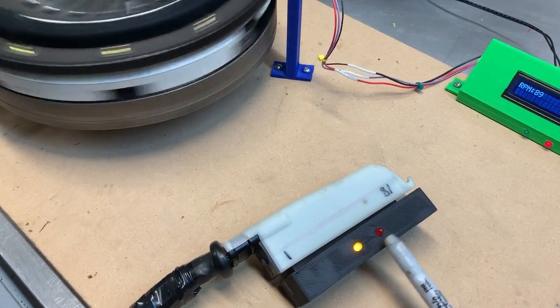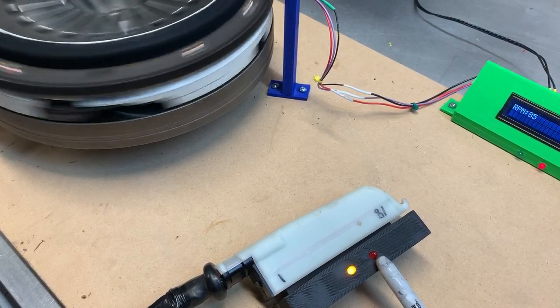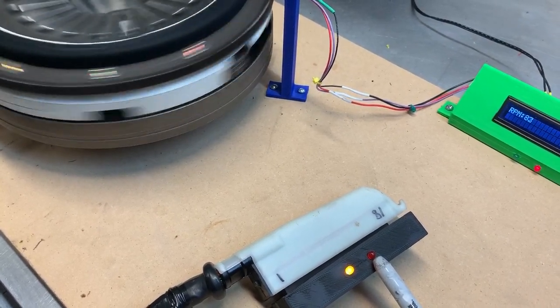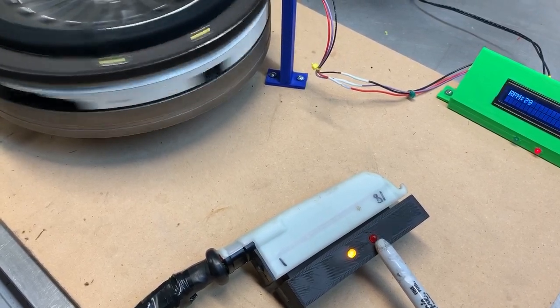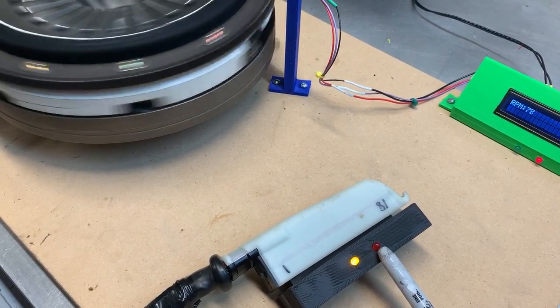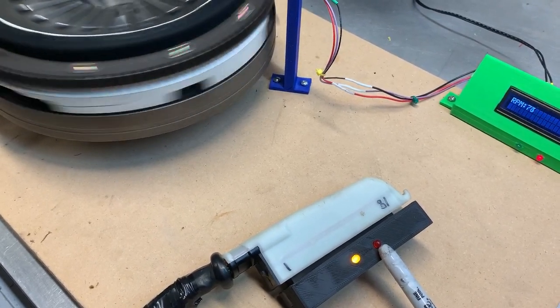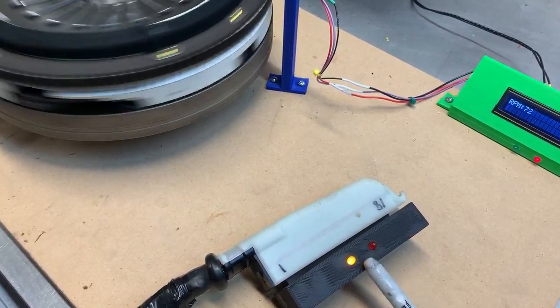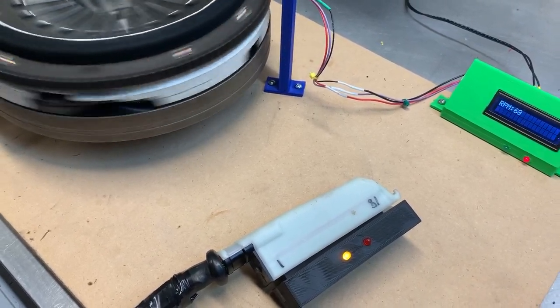It would not blink if you had an FAE sensor with a grounded shield cable. It wouldn't blink, of course, if you had problems with your harness. You could also wiggle your harness while it's running to see if either one of these stops doing its thing.